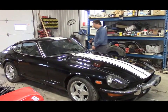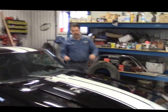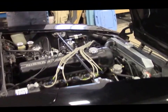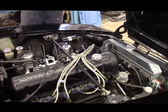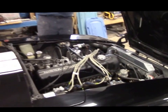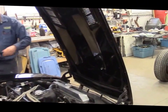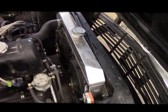I'll pop the hood and we'll take a look underneath to see some of the upgrades and how tidy and clean it is. The engine is nice and clean. Cooling has been upgraded — the drawback to these Datsuns was always cooling; they always had issues. So we have an upgraded aluminum radiator with two electric fans and a rheostat built in with an adjustable thermostat that will turn the fans on and off as needed.